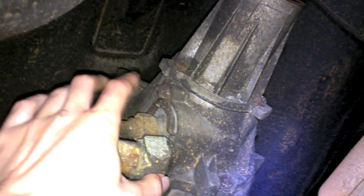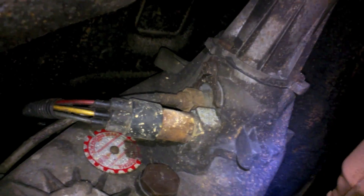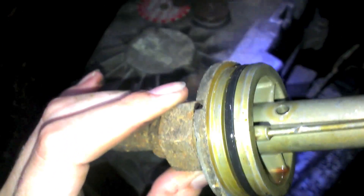You take this bracket off and pull the thing out, and then the gear will be inside there. I'm going to unbolt that little C-shaped bracket to get the gear. The bracket comes off, and then with the slightest tug you can just shake it free. There she goes — she just flew right out. So that's the o-ring right there that should get replaced or at least re-lubricated. And that's everything — that's what your speedometer cable hooks into.